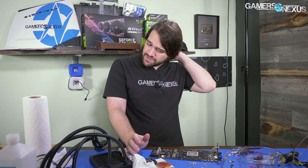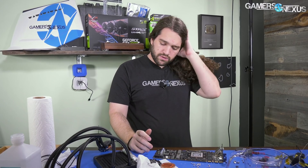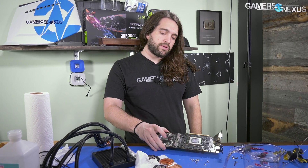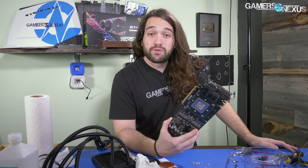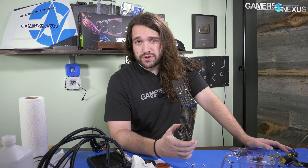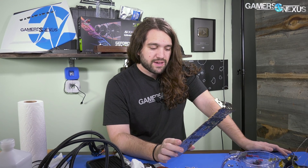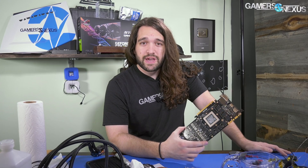What I think I'm going to do is put the reference cooler back on or an Arctic cooling aftermarket cooler — actually, I never noticed how that chip is raised up like that, pretty cool. I think we're going to put a different cooler on here just to be sure, see how it does with air. If it does well then I might put it back under liquid. If it doesn't, there's clearly something very wrong with its ability to regulate temperature. It doesn't seem like the cooler was at fault, and that was the point of opening two of them to make sure.